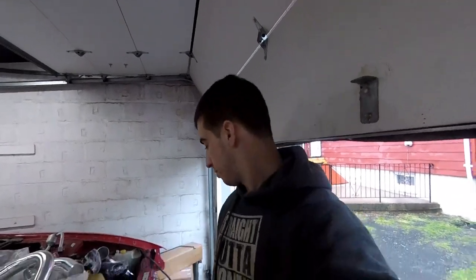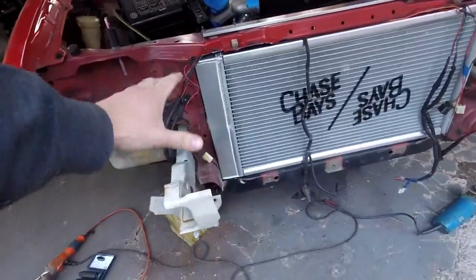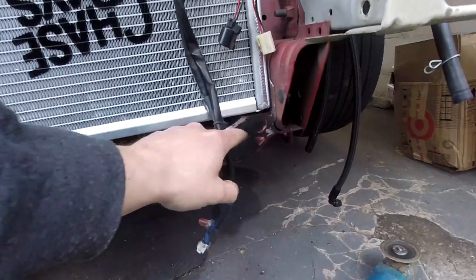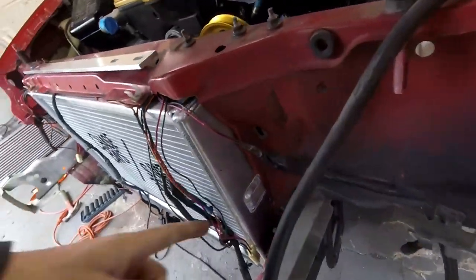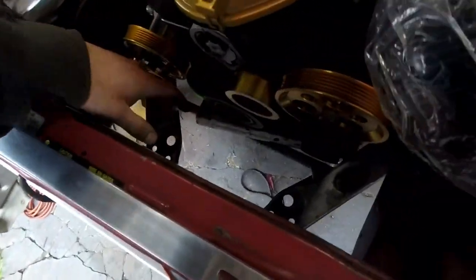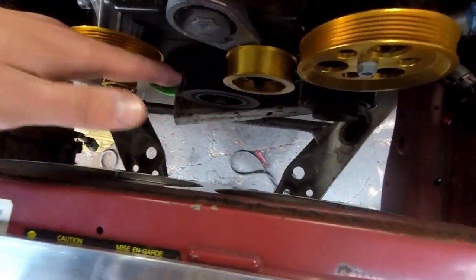Welcome back — this is another day. I've been working on this here on and off. I skipped a day in the video because it was really tough to find time and figure everything out. As you can see, I cut all this as you guys saw. I dropped the radiator in from here, pulled it in — had to chop a little bit here and there. The tabs are right up against the body, so I have to drill a hole through the tab and through the body to put a bolt and nut. Look at how much clearance there is — my fat fans can fit and I still have room to service the belt without having to remove the fans, which is awesome.